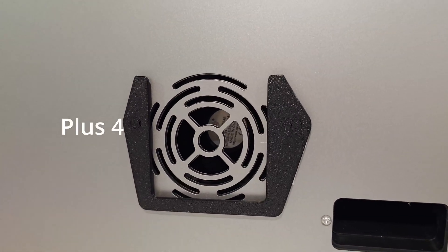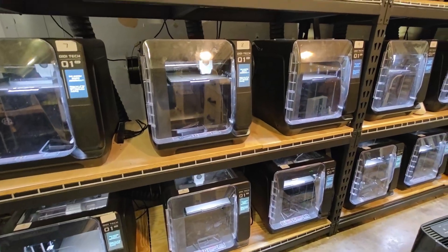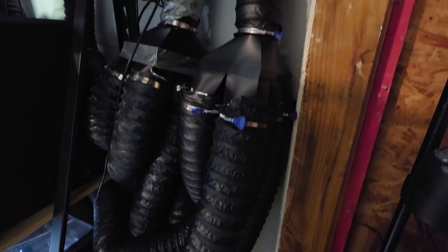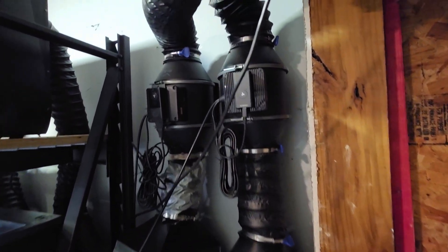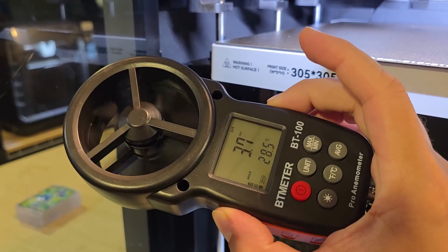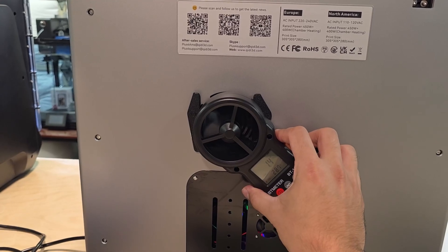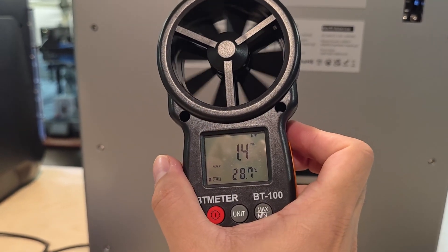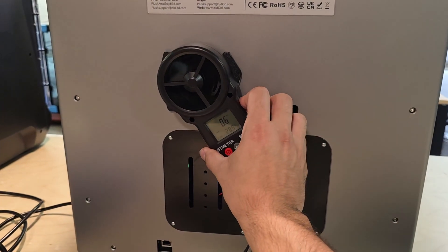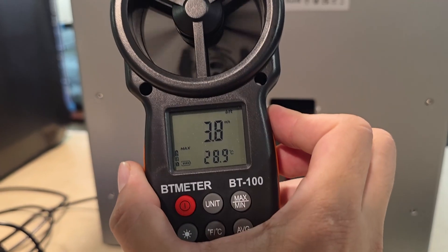Moving on to ventilation — both printers have exhaust fans on the back panel, and this is the main feature that led me to build my Q1 Pro print farm. With the Q1 Pro, you're able to maintain 60 degrees Celsius on the chamber while exhausting the fans at 100%. This is ideal for printing ABS so the fumes don't linger — it's always best to remove the fumes completely versus trying to filter them out. With the Plus 4, using an anemometer, I measured the flow of the heater fan and compared it to the exhaust fan. With the charcoal bag filter installed, there was positive pressure inside the chamber — the filter restricts the airflow and I don't think this is very effective. When removing the filter, there is equal flow from the heater and the exhaust, creating balanced airflow, which is the most effective way to exhaust ABS fumes. So do yourself a favor and just vent this to the outside if you can.